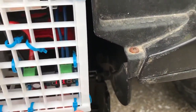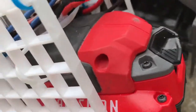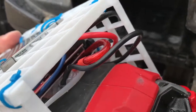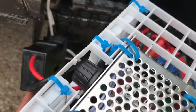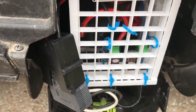I have a speed control here — it's just a cheap thing I got on Amazon. We keep it cranked up but for the little kids we can slow it down. I bought a broken drill on eBay, hacked the base off of it, and used that for the battery. There are some brands that have 3D-printed bases available but I couldn't find anything for this particular one. That wire is a little overkill — it's 10 gauge — but I'm using it for the inline fuse. The battery is fused and then there's another fuse that came with the Power Wheels wiring harness adapter, so that's two 25-amp fuses in series. It's not really necessary to have them both but they're in there and I didn't want to cut them up.